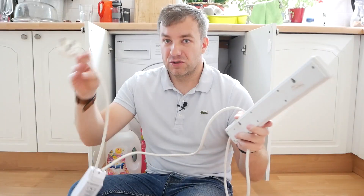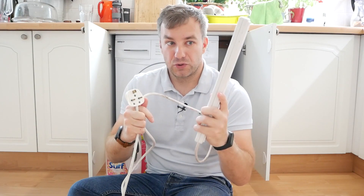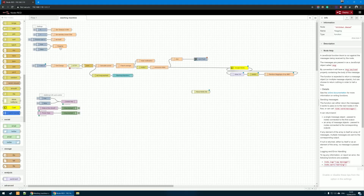All the programs are timed, so you might as well ask Alexa to set a timer and you'll get a notification on your phone or on an Alexa device. Thankfully, we could revert back to my original plan — using a power meter. In my DIY smart washing machine, I simply used a relay with a power meter and spliced it into an extension lead. That way I could monitor when an appliance is using power and use that as an automatic trigger. All I had to do at that point was make sure that everything is compatible.